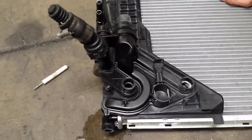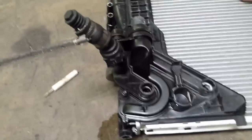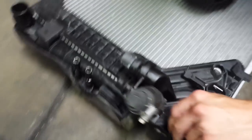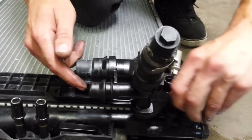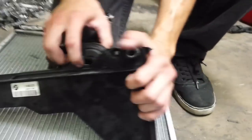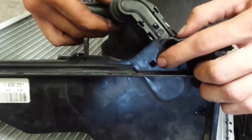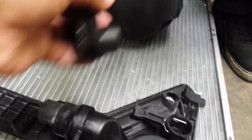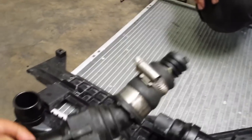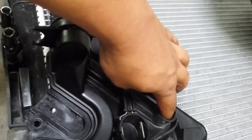There's one option here. However, what if you have your manual bracket? You can slide the bracket that goes to the side right here on your expansion tank out. You transfer it with the manual one — press on it, it slides out. There's a tab right here you can see through that little window. So you take it from your manual and put your manual bracket here. Then you don't have to cap the hose — you skip that step. You would just have to seal this one hole right here. Just one.